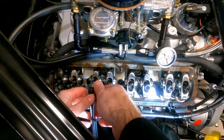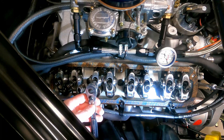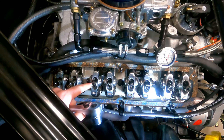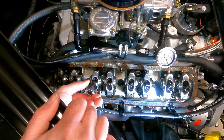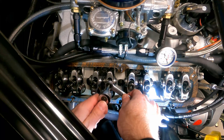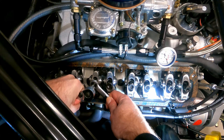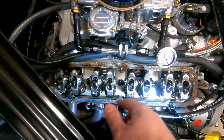This one's going to be a little harder — I have to do quarter turns at a time because of trying to get to everything. One quarter, two quarters, there we go — three quarters. Three quarter turn past zero lash. Also make sure you don't have the socket resting on the rocker arm because you don't want to push anything extra — you just want to adjust the nut. Now we want to go ahead and lock these down, spin them all the way till they bottom out, put the five-eighths wrench on here — set that, and set that. Number three is done. You just follow your firing order until you get all eight cylinders.